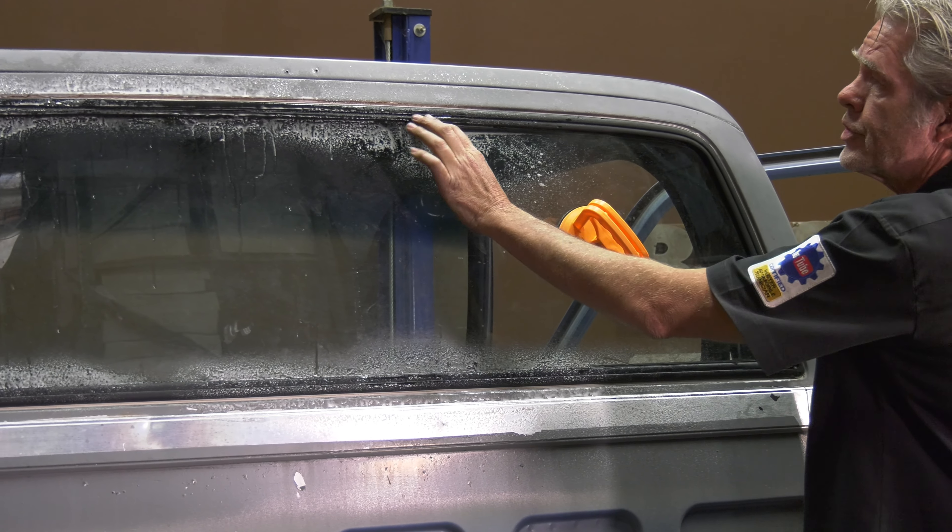I've got my bead all around the glass, but now I need to get everything centered and make sure that the groove where the bead lock is going to go in is wide enough for it. I'm working along the rubber to encourage that, making sure the glass is centered and not jammed too far to one side. Get the channel worked well, and then I can go ahead and start installing the bead lock. I'll install my little corner piece — this time I slid it into the rubber, jiggled it into place, then rolled this corner over and the other edge to get it fully seated.